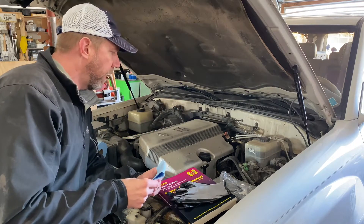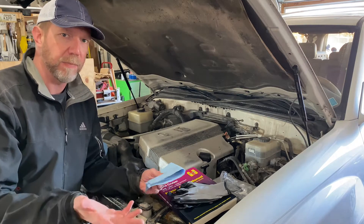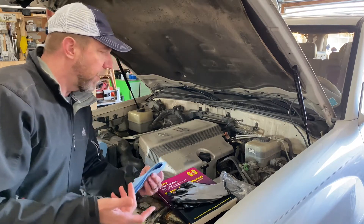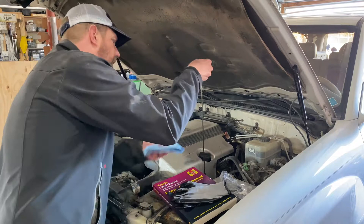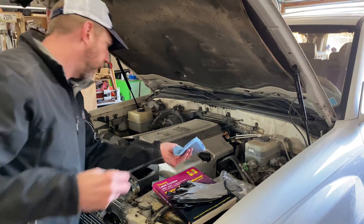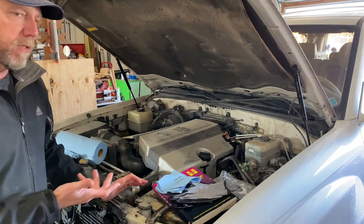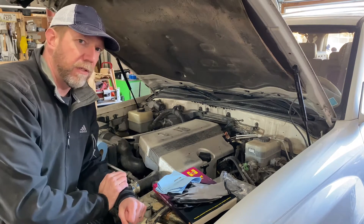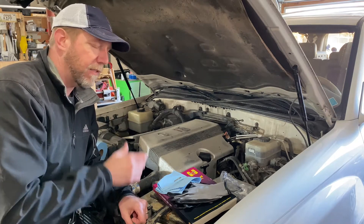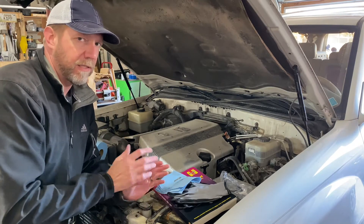This engine is running about 3,500 miles on this oil change — whether or not your religion says that's behind or ahead, I don't care, you can write your opinions in the comments. I went 3,500 miles anyway. What I usually do first is check to see if I burned any oil. In this case I'm sitting at one quarter to three quarter down. I can't honestly say on this oil change if that was the result of the engine burning oil, because we actually had some surgery done to the engine which would have pulled oil out a little bit. We also had a leak that we knew about that we fixed, so taking those things into consideration, it's probably burned a little bit of oil, but to what extent I don't know.